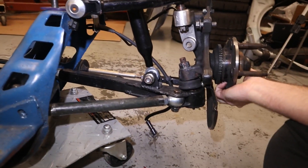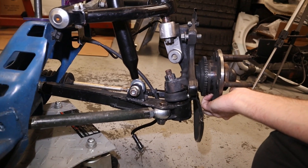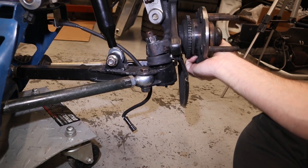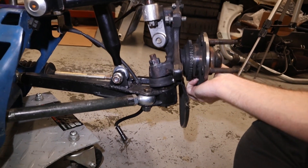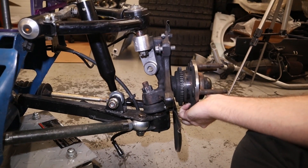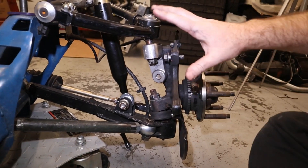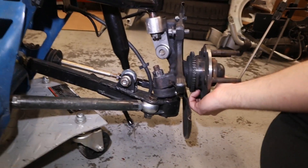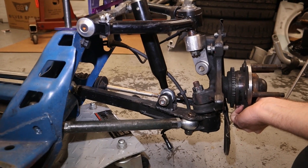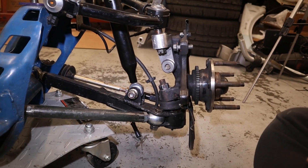With the lower control arm being level, the upper control arm has an angle going upward. So that means as we go up, we are gaining negative camber as we move upward. The same can kind of be true going down — we could be gaining a little bit of positive camber as the upper arm crosses over its longest point, and then as it continues down, we're gaining negative camber again.